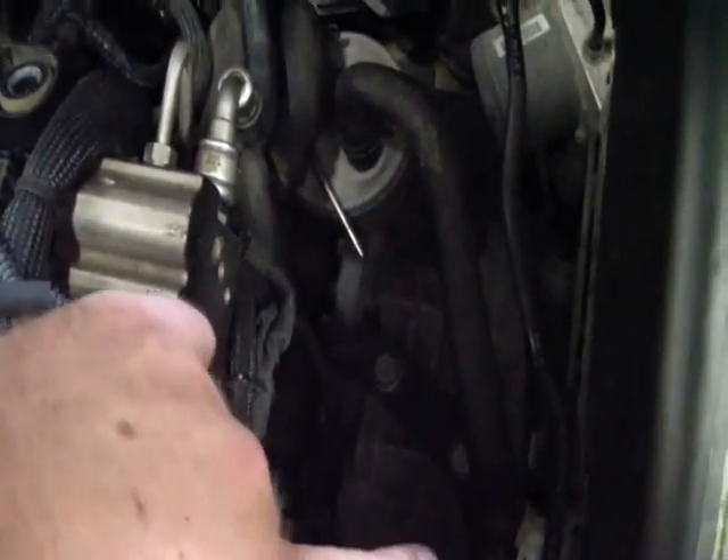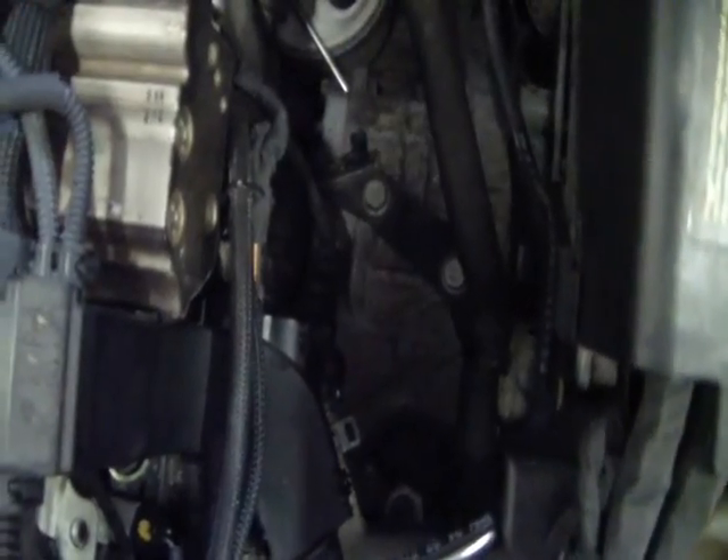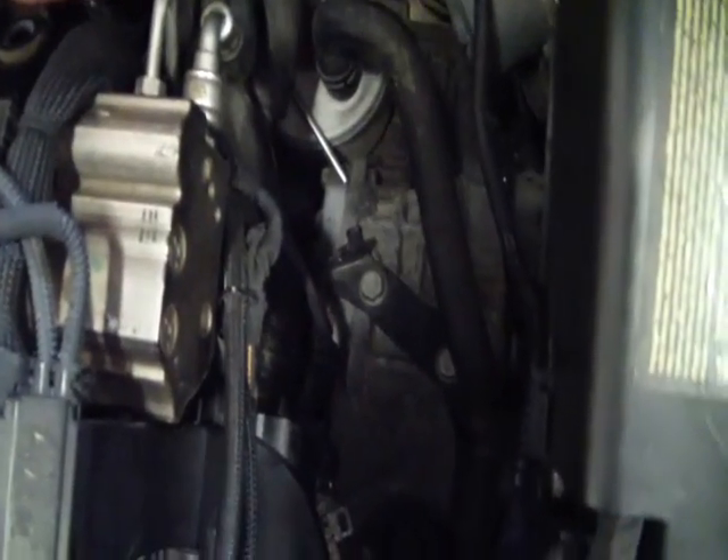Underneath the hood, you have to remove the airbox — the airbox is gone along with the tubing. Then right down here there is a 13 millimeter nut. I've already pulled the cable out. Remove the airbox, undo the 13 millimeter nut that's on the actual selector lever of the transmission, unclip the plastic clip back there that supports the cable, and then start feeding it down through.